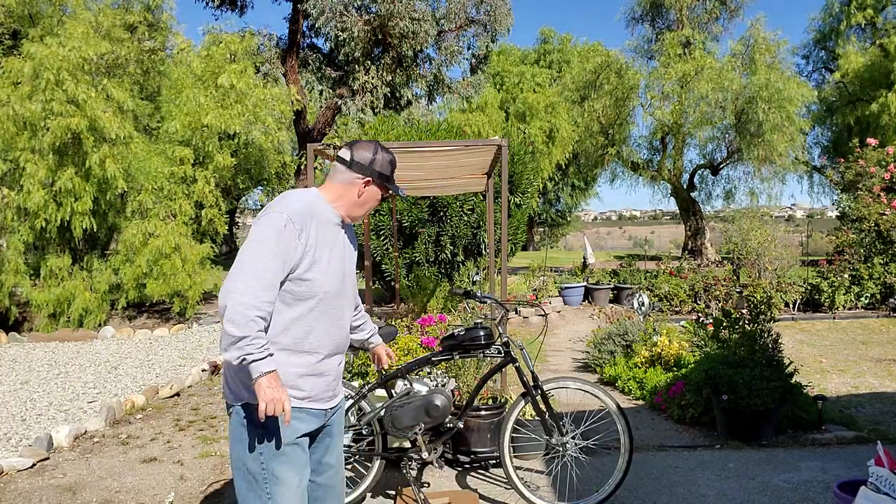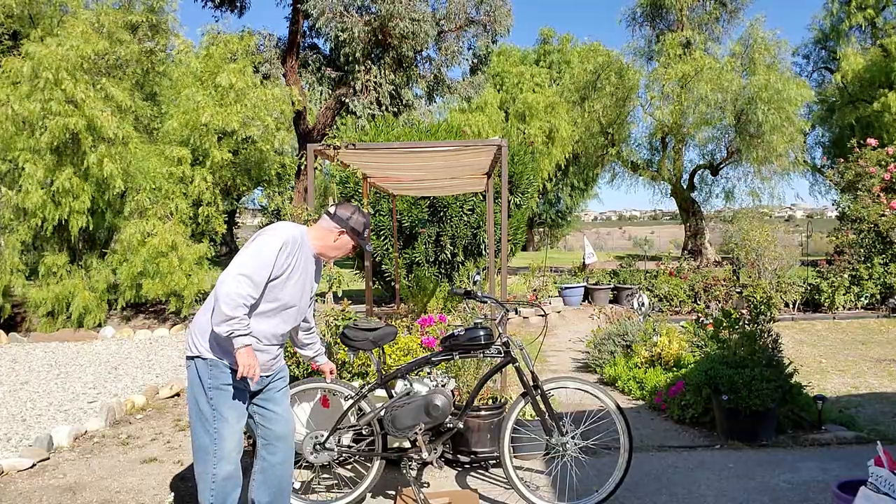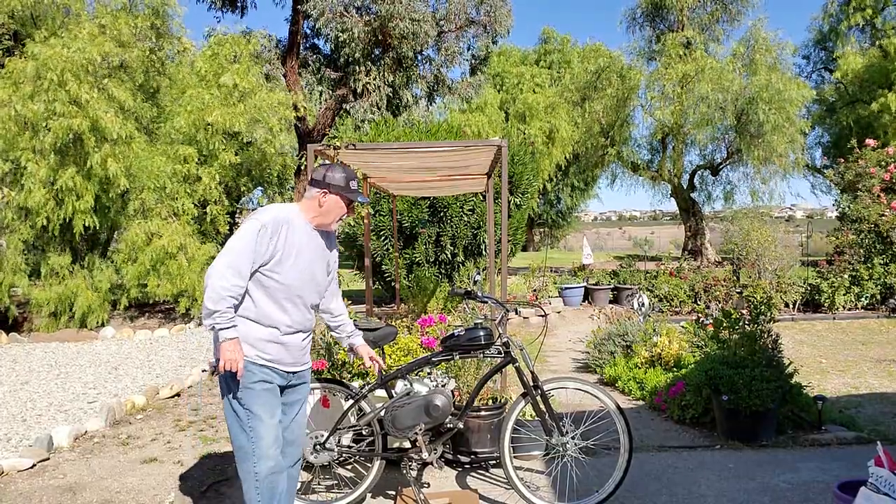So I spent half a day with these bike rims. I'm sending back the Flying Horse one, and now what I've got on the rear is the Grainger 11-gauge spoke rear wheel with the aluminum hub adapter from BikeBerry and a 40-tooth sprocket. This thing seems solid — it's probably the most solid part of the whole bike. And then in conjunction with that, I have the 12-gauge front wheel with the disc brake from BikeBerry. There's not as much pressure on the front since there's no drivetrain there, so that's okay.